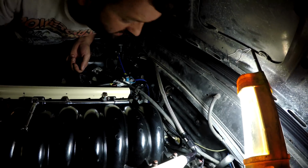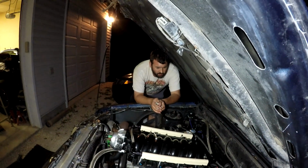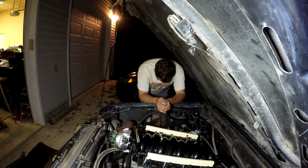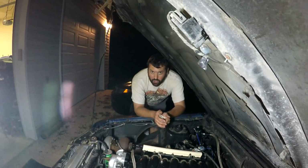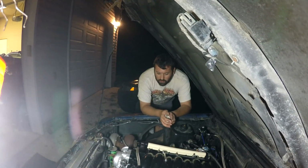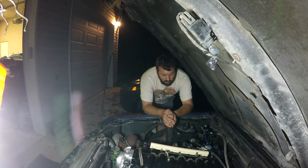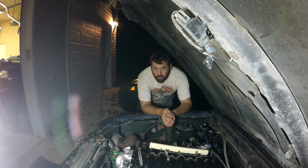On closer inspection, the oil tee that we have here all seems dry. I don't know, it's something behind the rear cover. Well, it has to be the rear main seal, really, because that's the only way out of the cover. But like I say, the way it's coming out, it's like it's coming from a pressurized oil gallery plug, but you're saying there's nothing on an LS back there? Well, it could be that plug on the side of the engine, but that should be on there and tight. We put all the plugs in, and it's coming from like the center line of the motor. Yeah, well, that'd be the rear main seal, in theory. Which was brand new, right? Yeah.